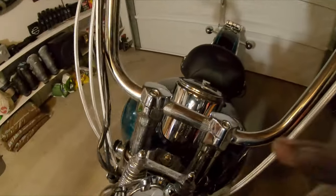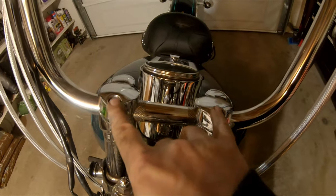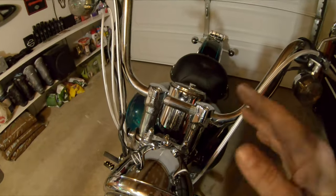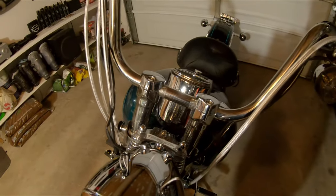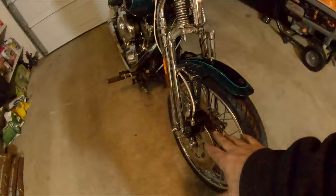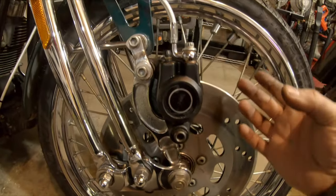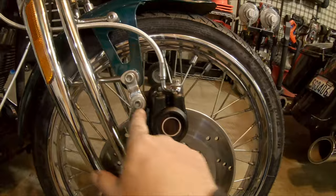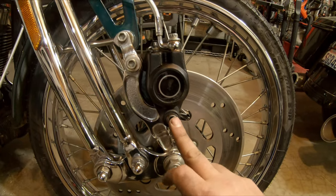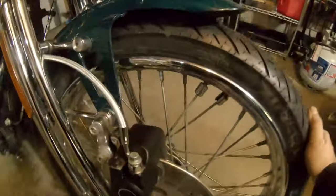Had I purchased Springer bars and didn't have this exposed knurling — if all the knurling was centered — it wouldn't have been an issue and I wouldn't have had to use that plumber's tape. But the bars were free, so I figured what the hell, it's a $5 investment on the plumber's tape and I think it's going to work just fine. Front tire's on — that axle nut was the same 63 foot-pounds. I had to pull two bolts to pull the caliper off. I don't know the torque specs on those, so I snugged them up and gave them a little Loctite so they're not going anywhere.